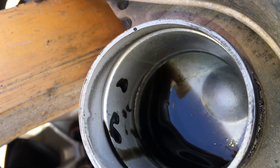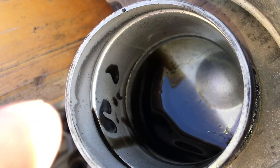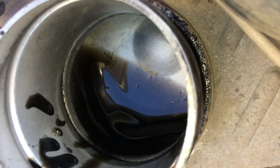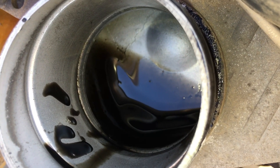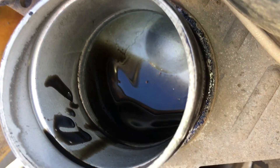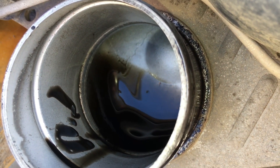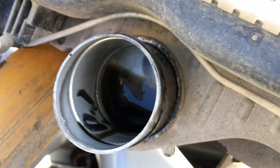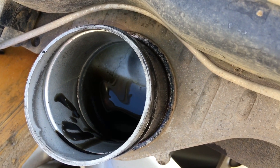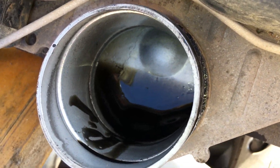Look in here — I've seen intercoolers where we've done this and there's no oil at all, maybe less than 5 mil. So this is probably one of the bad ones. Nearly 200,000 k's, and there's 20 mil of oil in round figures. If you got every last bit with a rag and waited maybe a couple of days, you might get another three or four mil tops. Anyway guys, there's the real information. If you learned something from that, give us a thumbs up, subscribe and turn that bell on so you don't fall behind.